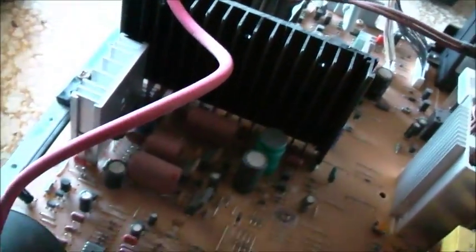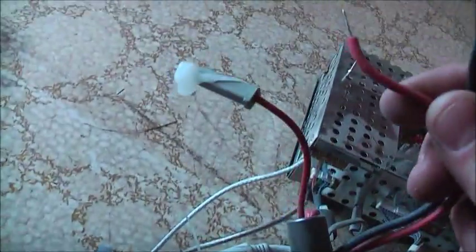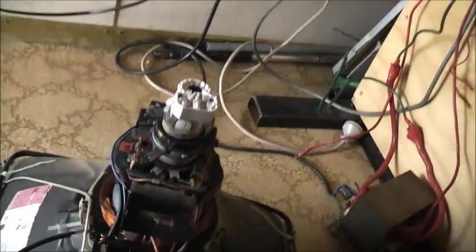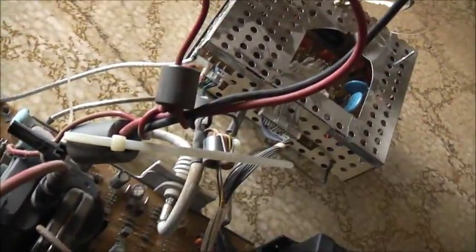I'll leave that for a bit later on. I'm going to hook that one out and test it. Decided to strip this thing down, since this flyback is designed so you can't wind your own primary on it — it's just a pain. Now, for those of you who don't know, I like my flybacks complete with these wires all intact. Basically how they disconnect: this little assembly clips in half and unplugs. Where the flyback would normally slip off, you bend these tabs up and in, and that unbites and lets go on the leads. Sometimes you can rip these out, but you can see they're actually gripped and bit into the wire, so you can get a little bit of output on those as well.